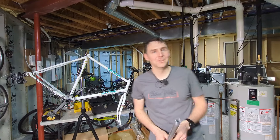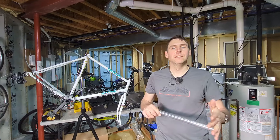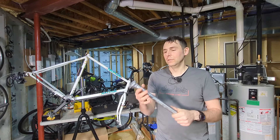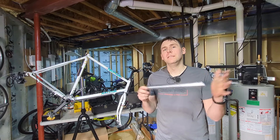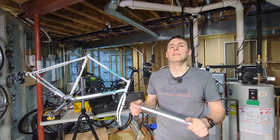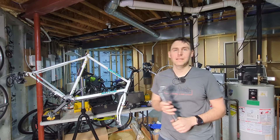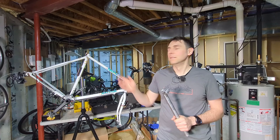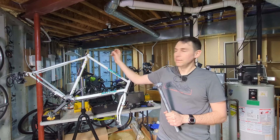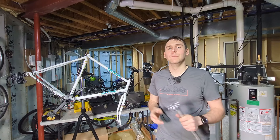What's going on YouTube? Welcome back to Spinning True. Today I'm trying something a little bit different and I'm going to show you a way I found to slightly sand down a seat post if it doesn't quite fit into a bicycle frame correctly. So this is a 1988 Raleigh Technium. I don't know what the original seat post diameter was but I measured it using a seat post sizer and it came out to 26.8 millimeters.